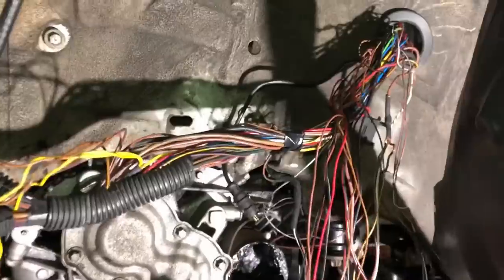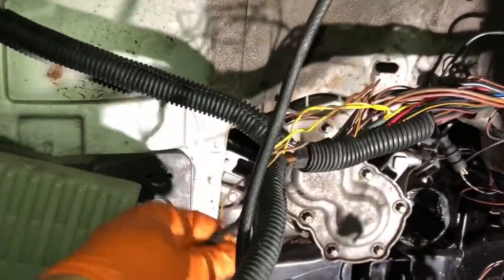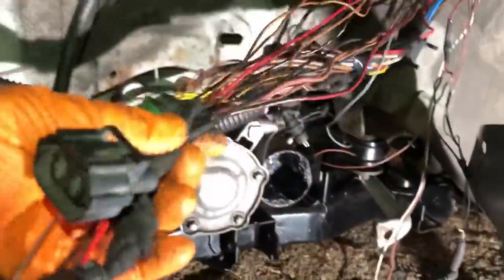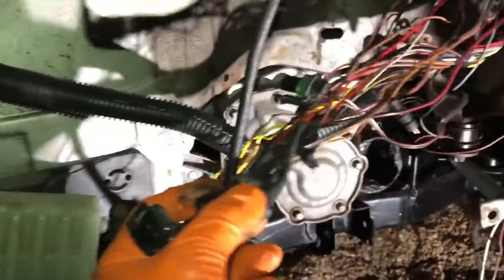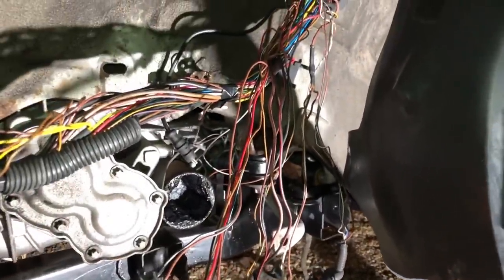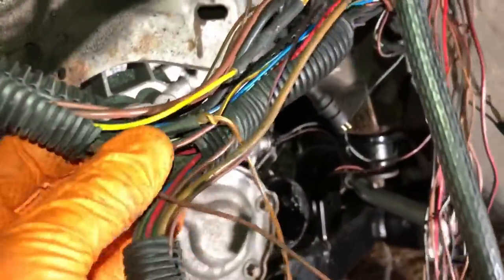This is the section in the wing - I'm separating any wiring that needs extending. It all goes around here but we're falling short by about a foot with the headlight wiring, which is on a separate loom. You can see it's got to come up about a foot around this corner up to where the headlight sits, so that's all going to have to be extended. I'm also going to cut out and trace this slot back as it's not needed - it's for the old alarm system.